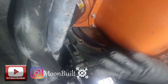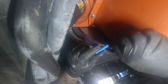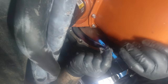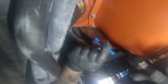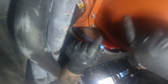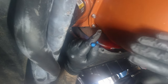These Felpro snap-ups are a great product. On the front I had to keep them out until the gasket and pan were up past the cross member, but once everything was in place I threaded them in and it kept everything aligned to get the pan buttoned down. Now I can torque all these down — I'll have to look up the torque spec — and then I'll be ready to add oil and check for leaks.